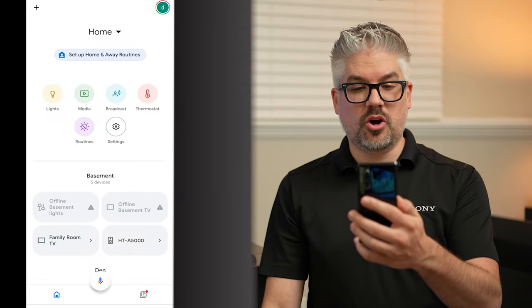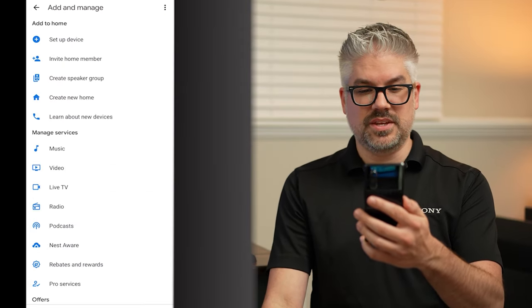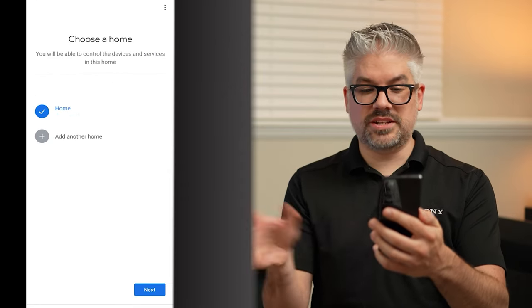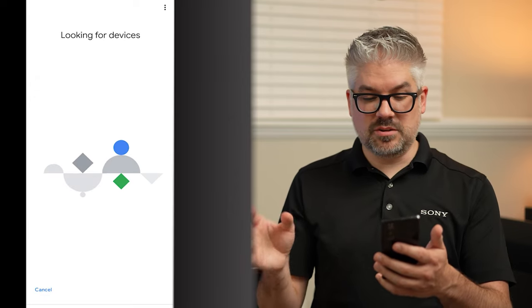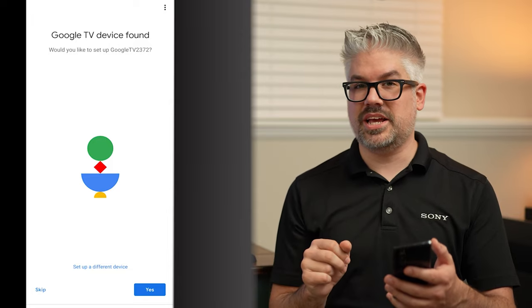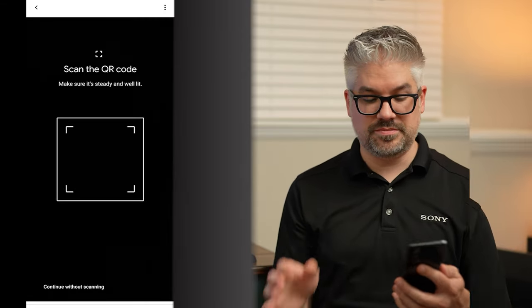How do you do it on the Google Home app? Very simply. Open the Google Home app and in the top left hit the plus icon, then select 'Setup Device,' then 'New Device.' Select the home it's going to go to. It's going to look for devices, and once it finds your Google TV, it'll list it there. You'll say that's the one you want to connect to, and it'll ask you to scan the QR code. Once you scan the QR code, the TV and the phone essentially take care of all the initial setup — connecting to your network and getting the TV ready for your entire Google experience.